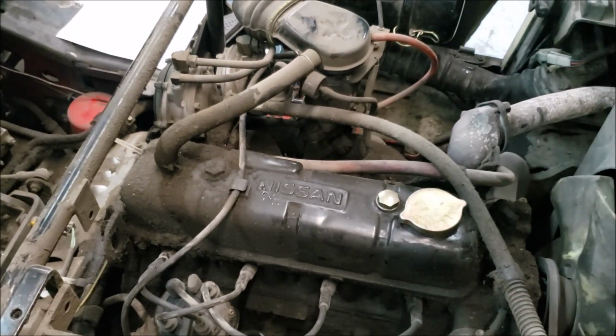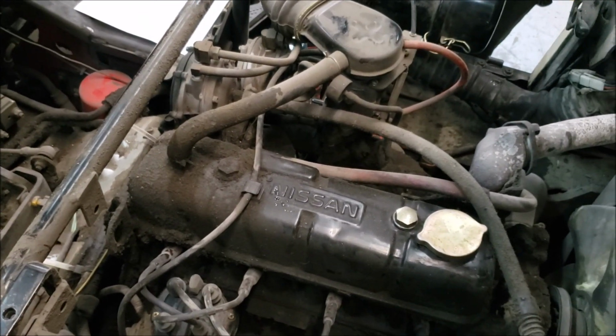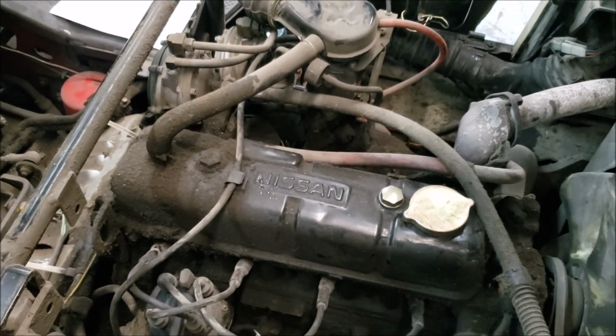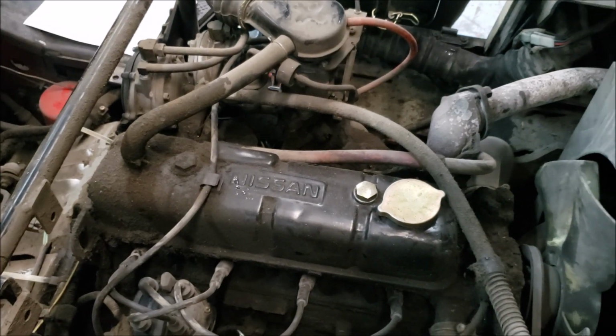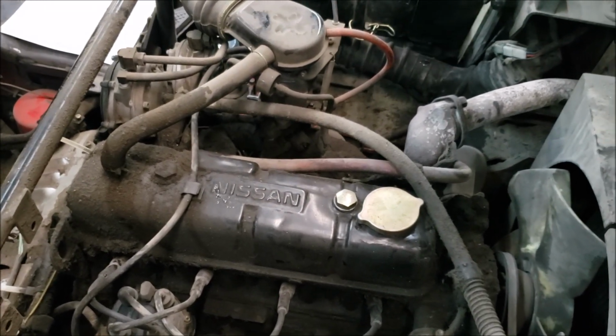You see the voltage drop down to 4 volts. Okay, that's fine. It could be a battery, but that's why I always carry an amp clamp. Or if you measure the voltage at the starter, not cranking, just when it's key on. Same thing, right?